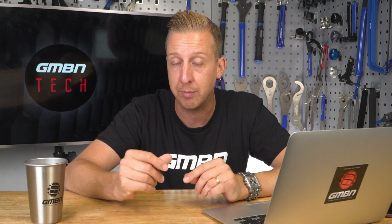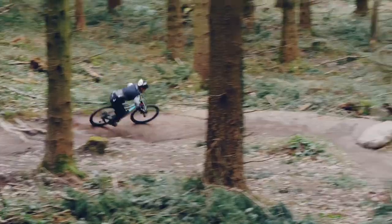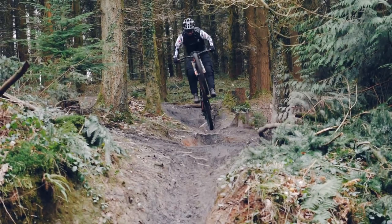The wheel actually has to do quite a lot — it's got to cope with all the twisting forces from riding, like pushing your bike into a berm. Don't forget the hubs front and rear can't form part of the structure of the bike, and they've got to cope with acceleration and braking going in different directions. So it's really important you pick the right option for you. Two cross has shorter spokes but because they don't overlap as much, they're not quite as strong. They might be ideal for cross country, but if you like to throw your bike around, three cross is probably going to be better.